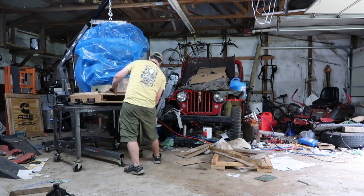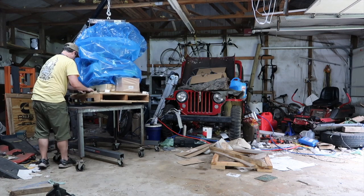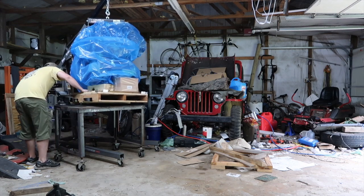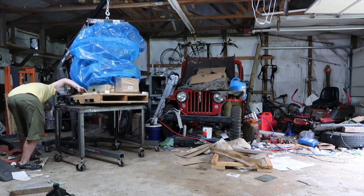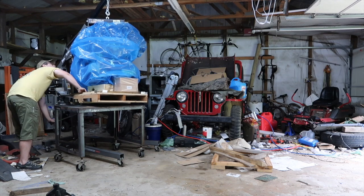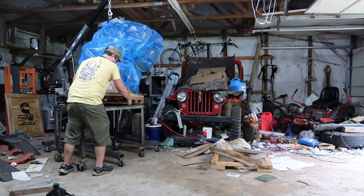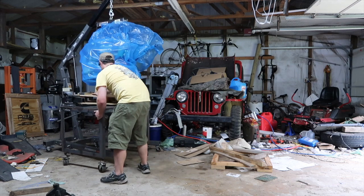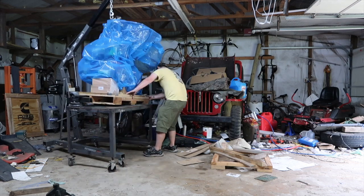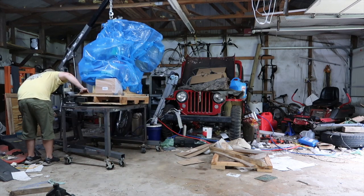Having the 4-liter, it's a great engine, but it doesn't have nearly enough low end torque. It has okay torque if you gear it quite a bit. This one's got 307s. It came with 33-inch tires, so in 5th gear I wasn't going anywhere. And even now I've got 29-inch tires on it, and you were constantly fighting it on the highway. It just could not maintain speed.